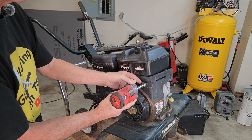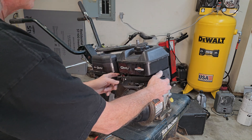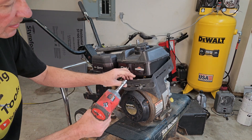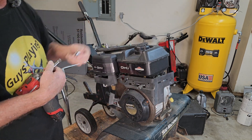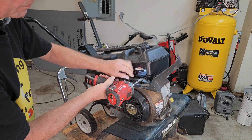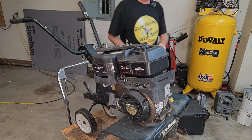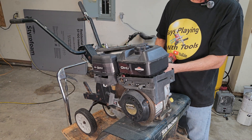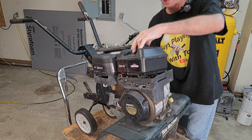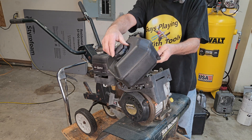Let's get this out of the way — this didn't come all the way off easily. We're going to go up in size to our trusty seven-sixteenths. Because she's a leaker, we don't have to worry about the fuel — it doesn't have any. There we go, and she's loose. The gas cap also has an escape hatch, and that's it. The only thing we've got left is the little clamp here.